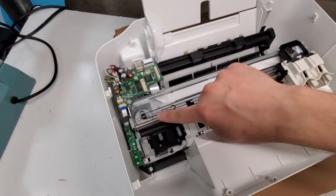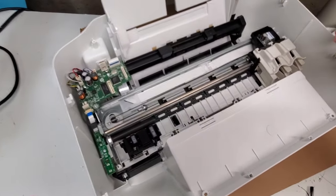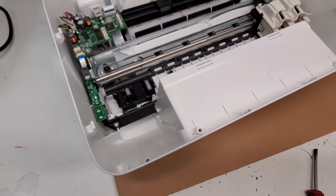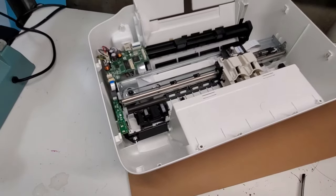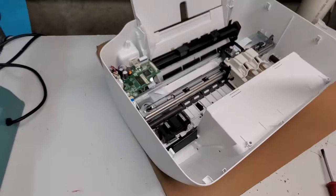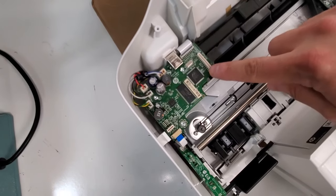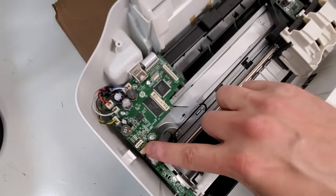This tiny encoder strip needs to be clean. If there is a mark on it, you can look at it — if it's clear it's in good condition. If the carriage unit is going back and forth hitting walls and giving you errors, check for that: there could be a mark of ink or grease on the strip. If a scanner error comes up, make sure this connector is connected correctly when you put the scanner back.